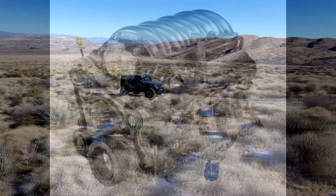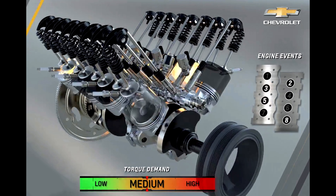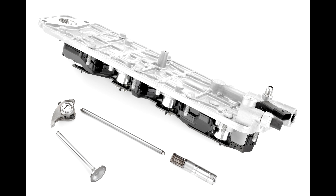That's going to move us into the next generation of the LT, which I'll call the L84 and the L87. The L84 and L87 are essentially the new version of the L83 and L86. They ditched AFM — active fuel management, the four-to-eight-cylinder mode — and added dynamic fuel management, which is a two-, three-, four-, five-, six-, seven-, eight-cylinder mode, so the engine can run at pretty much any cylinder count. That obviously gives you a little bit more economy, and more importantly better drivability, because instead of just going from four to eight cylinders, now you've got all eight cylinders to work with. To implement DFM the way GM wanted, they took the lifter manifold assembly — where the solenoids were housed for the earlier LSs — and moved the solenoids directly into the block.